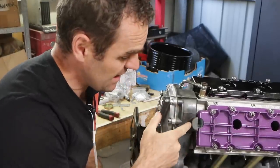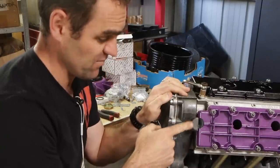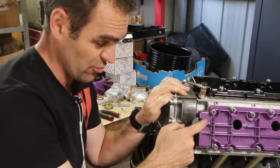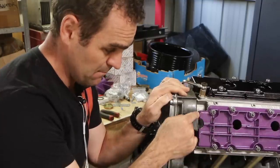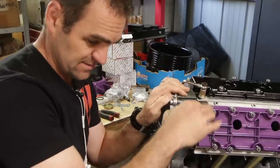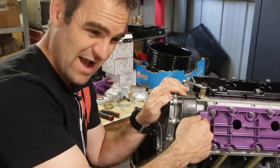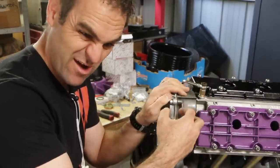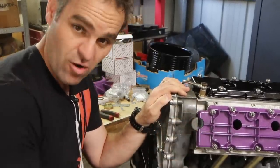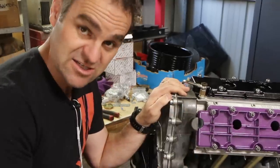I mentioned in an earlier episode that the casing looks like it's actually designed to have twin plugs, but they also have this casting on them that's just capped off. To get the spark plug in, Neil's already cut out the lower valve cover, but this part here I need to cut off. I've got a plug loosely in the hole down the bottom and I've stuffed in some rag — I'll soak it in oil so any shavings stick to the rag rather than flying around as dust. I'm going to carefully cut this off with an angle grinder, so fingers crossed I can cut it neatly and then we'll have access to the spark plug holes.